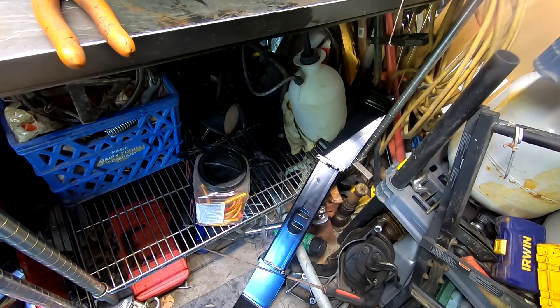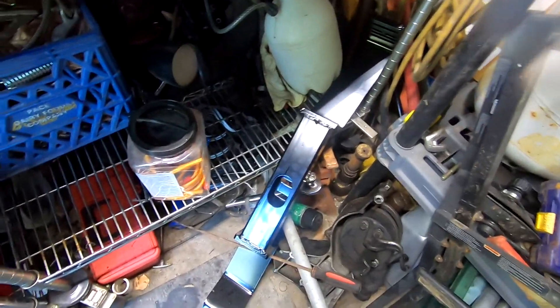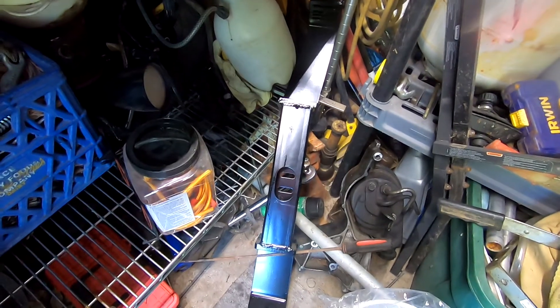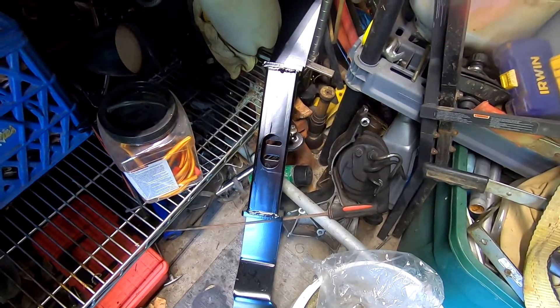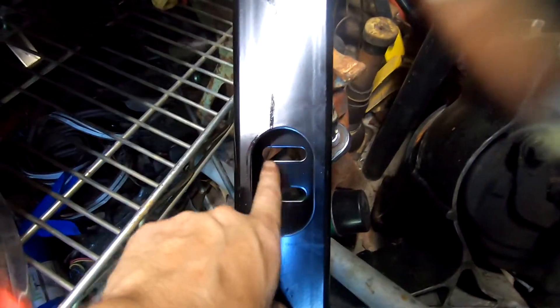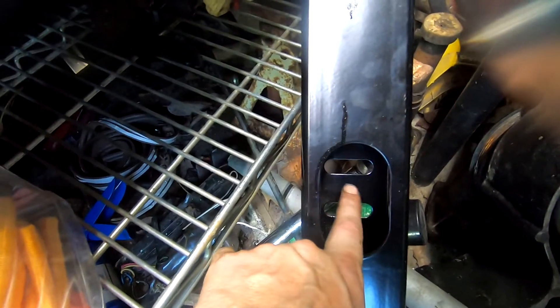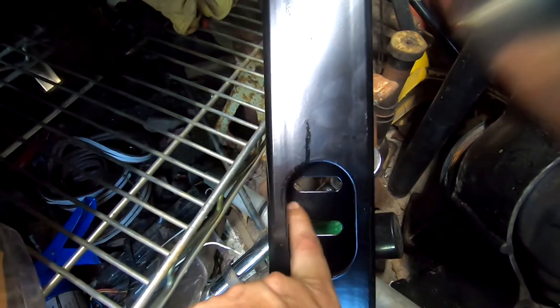I have the transmission mount but I may have to alter it — I have a single-bolt mount and the application needs a two-bolt. I might take this one back and see if they have the two-bolt version, because I don't want to drill it out and weaken it further. I'll probably do that tomorrow — I'm not in any rush. Hey, if you haven't already, go ahead and like and subscribe, and I'll be coming back with more stuff later.